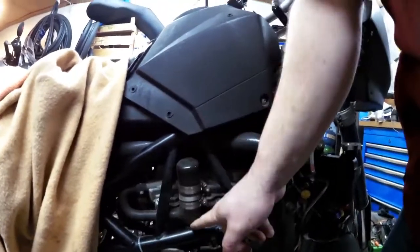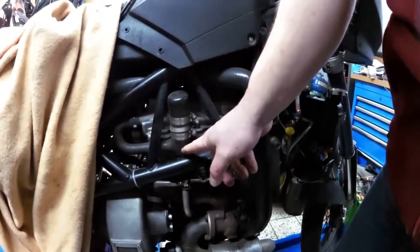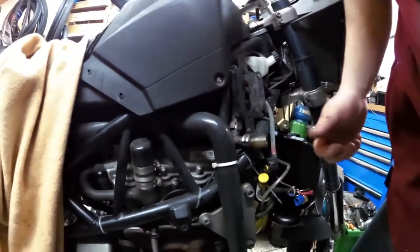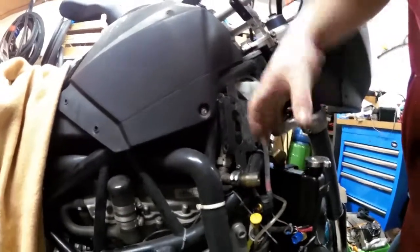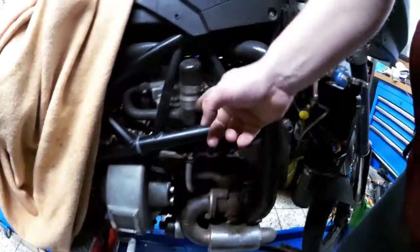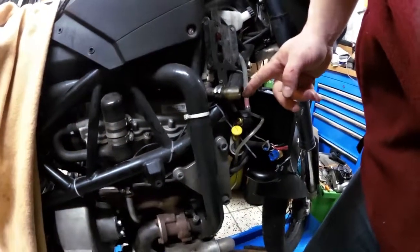Okay. Anyway, details. A little something about my track here. This is the vent line from the engine. Goes into the oil separator here, and then out the top. And this goes to the other side of the fuel tank, and it comes down here again, over the base of the tank, and then into the inlet of the filter here. And this prevents oil running straight from here into the filter when it's turned on the right side. But, you know, little details.